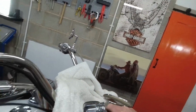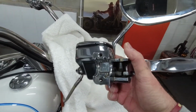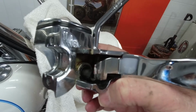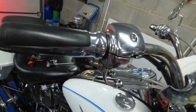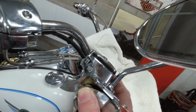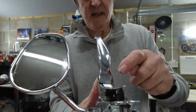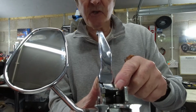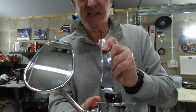Well, here's the brake lever. Now you can see that little lug there. That little lug actually compresses that microswitch in when it's in place, so that when you pull the brake lever, it moves it forward and moves it that way, and so the microswitch actually releases. So when that little lug there is connected in place, it is compressing the microswitch all the time, so that when you press the brake lever and you move that, that releases the microswitch.